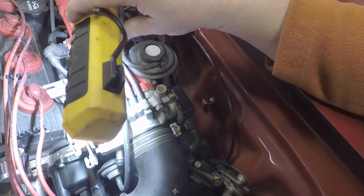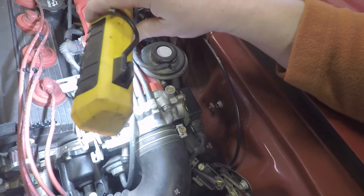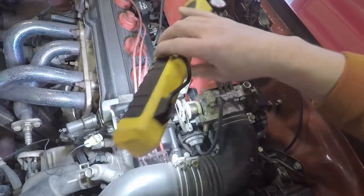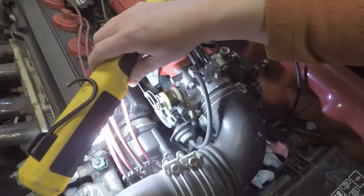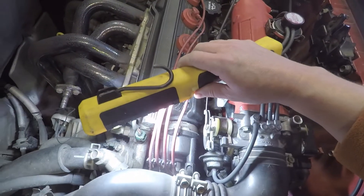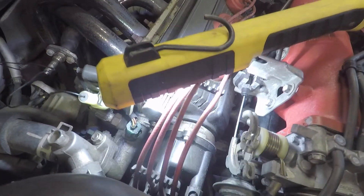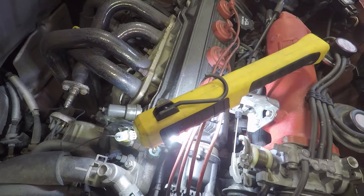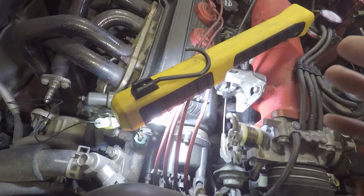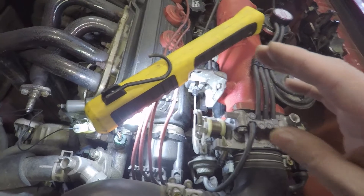In the next few weeks, if the throttle body bubble issue is still a problem, I'm going to be checking some other things. People suggested I check out the water housing thermostat — this green plug right here — to see if that's gone bad. Or maybe it's this water temperature housing here — those could be bad and sending a bad reading to the computer. There's a lot of things that could be going on, so let's go exploring.